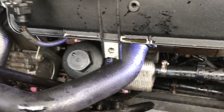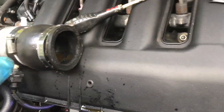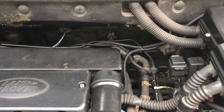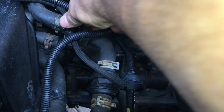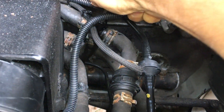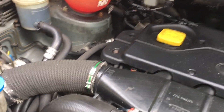That's it — just got to reassemble that part of the manifold I did take off for a fraction more room clearance. You could take this inlet manifold part off as well; there's a bit more involved in doing that but there's just about enough room to do the job. You need to bleed the air out of the cooling system because some air will have got in. First, refill your expansion bottle, then loosen this little screw bolt here until you start to get bubble-free antifreeze coming out.